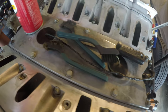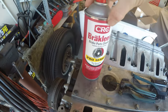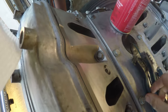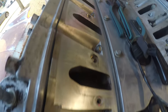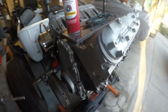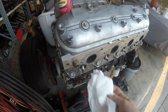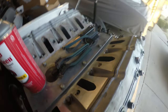All right, here's the tools of the trade: I've got just some plastic brushes, metal wire brushes, and a huge old can of brake cleaner. Basically what I do now is just spray some brake cleaner on there and get in there and scrub it out. You can see I've started here on the driver's side head cleaning things up, but on the passenger side you can still see some dirt in there. So I'm going to keep going on the whole entire engine — it's just a matter of sitting there and scrubbing it and spraying brake cleaner. Then I'll take a paper towel and wipe it off when it's wet to soak up some of that dirt. It just takes a couple hours to do the whole engine.